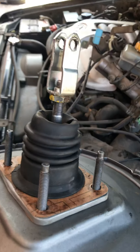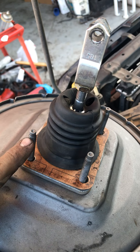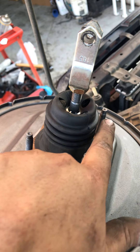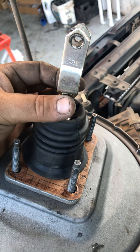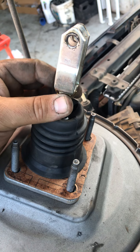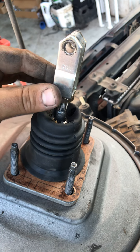Right here is the back piece of the brake booster, which goes inside of the car. There are four 12-millimeter nuts. You also gotta remove this nut here and this bracket to go on your new booster.